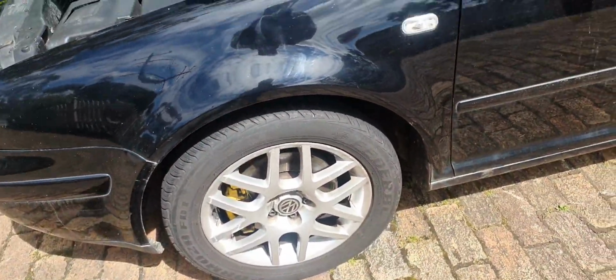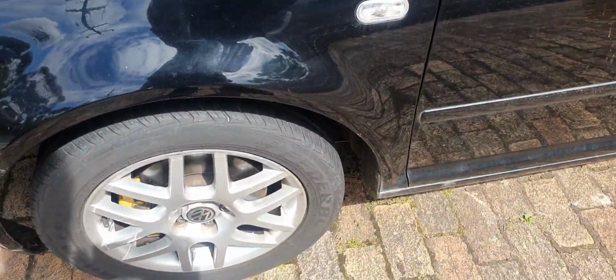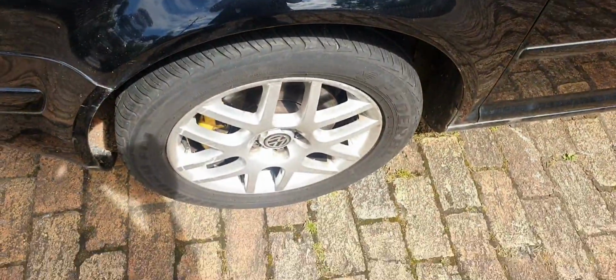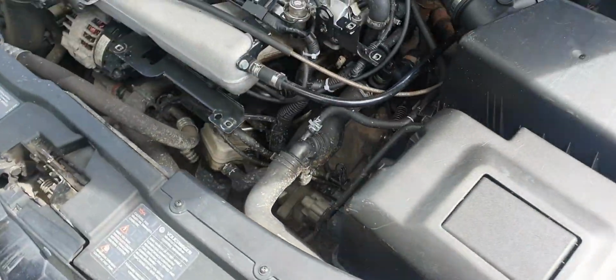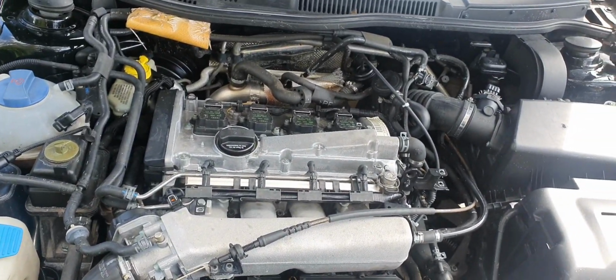The brakes are good, surprisingly. It's got lots of pad life for front and rear. The only thing I need to do is to change the control arm bushes, because they're cracked, so we've ordered some new control arms. So the whole suspension needs to go down. Well, I need to jack it up and remove the control arm and replace it. But otherwise, yeah, coming along nicely.